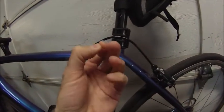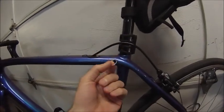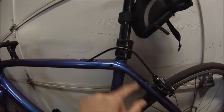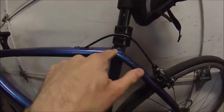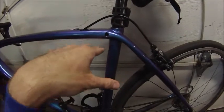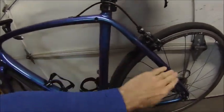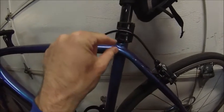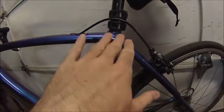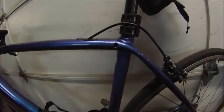Before you do that, get some of these little hair rubber bands that you can get at any store — Target, any drugstore, any place. I put the bike in my stand, holding it gently with a towel, tilted it so the rear end was up in the air, then stuck the clamp in. I was able to slide the seat post in — it took one or two tries. Stuck it back in there very carefully, then I stuck the seat post in and tightened the bolt up to six Newton meters and you're good.